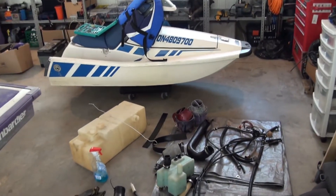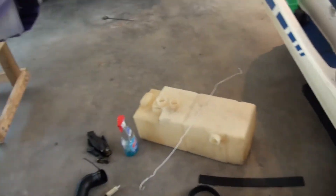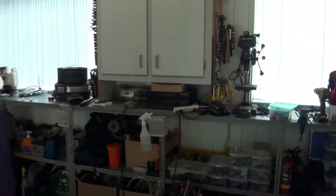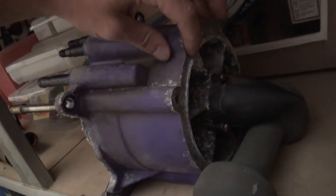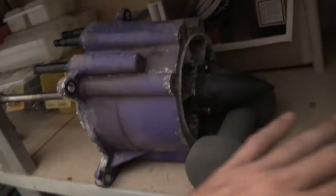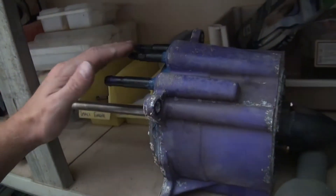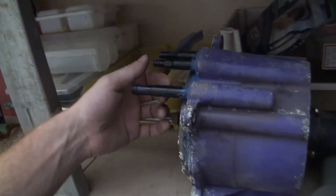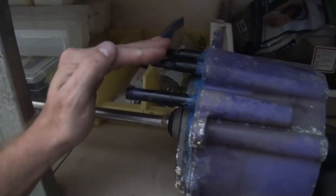The baler pumps are actually kind of interesting too. If we look at this pump here, there are two tubes right here connected to the nozzle. The nozzle has a very important function — it's actually the thing that creates the suction that sucks the water out of the hull. The water that makes its way into the hull is ejected through these two tubes.